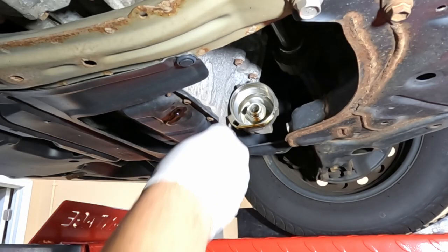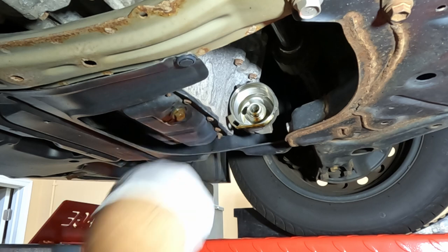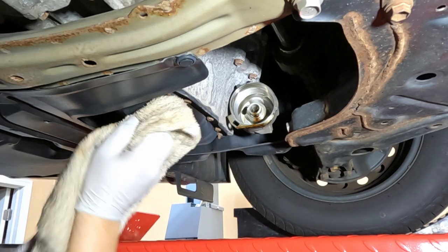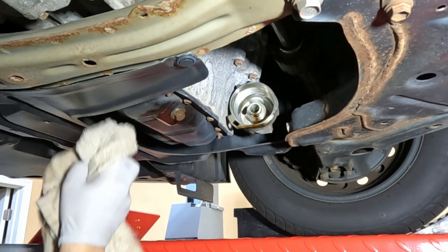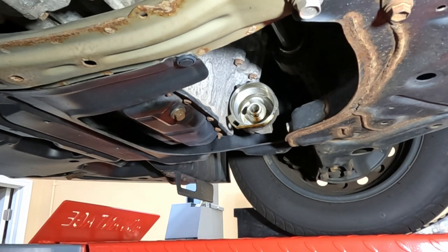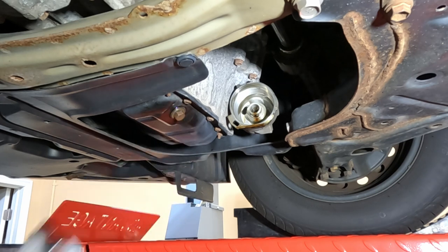Now we're down to a really slow drip on the oil, so we're basically low enough. Check your gasket — if it's leaking, definitely replace the gasket. It's also not a bad idea to just replace it if you want to; mine looks pretty good so I'm going to let it be. The torque on this drain plug — I'm going to throw a torque wrench on it just for the video. I've seen some conflicting numbers; 27 foot-pounds seems to be roughly where you need to be. This doesn't have to be precise, this isn't a head bolt. You don't want to over torque it or under torque it too much. So let's dial in 27 foot-pounds — it basically has a snug feeling to it, nothing crazy.